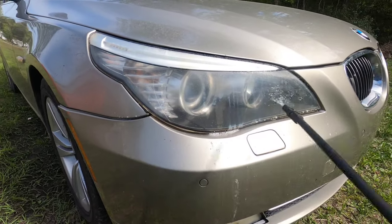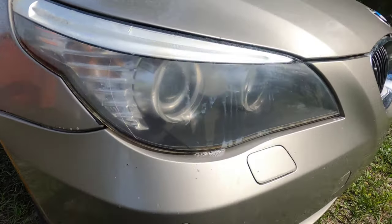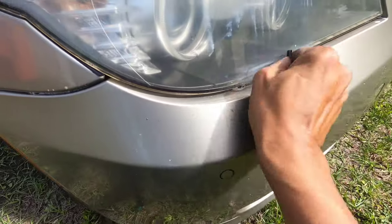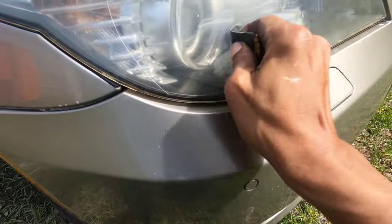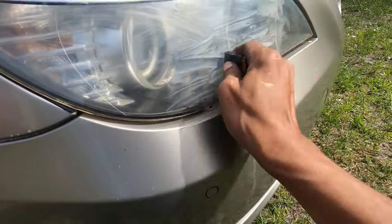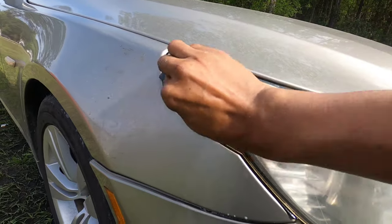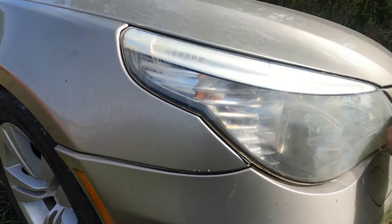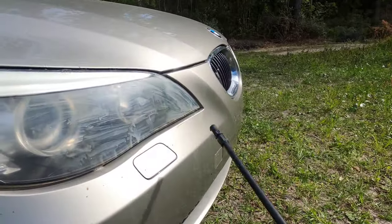I'm not going to be able to get all of these lines out of the light because it's really damaging. I'll give it a little bit more sanding — this is going to be the last time I do these lights because of the line damage. I don't know if something spilled on the light and caused that. The next time I'll be replacing them. Some people put a sealer on these after they do this, and that's to help keep the lights from fogging up.